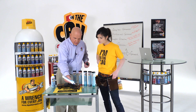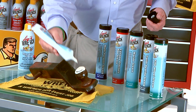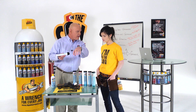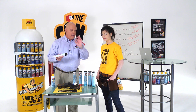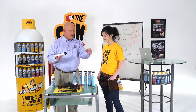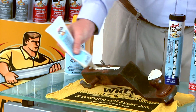Also, it builds a good thick layer underneath the hitch, so you'd apply it to the ball — it's kind of like frosting. When you drop the hitch on it, it squeezes down around and covers the ball, and you get a layer essentially between the hitch and the ball, and it just floats on that layer of grease. You can also use it on the hitch itself as it goes into the receiver. You put it on there just like that.